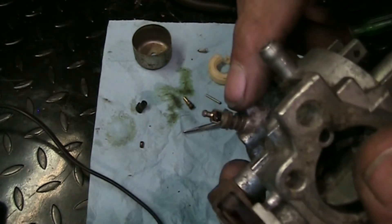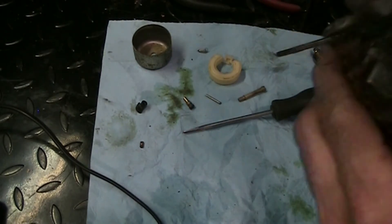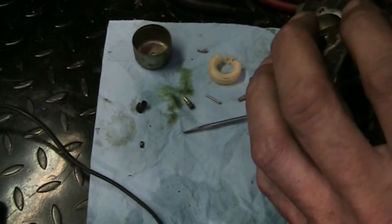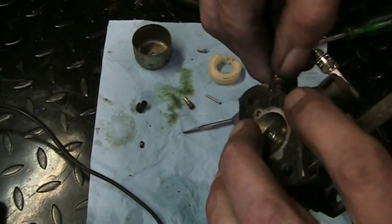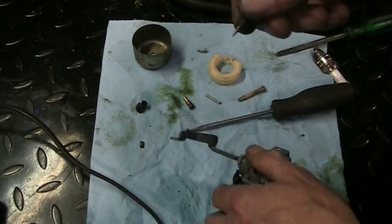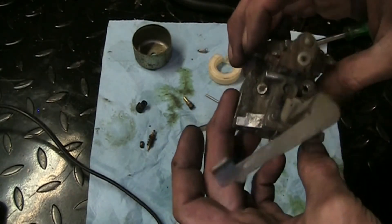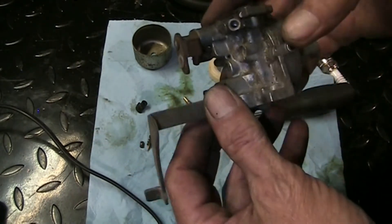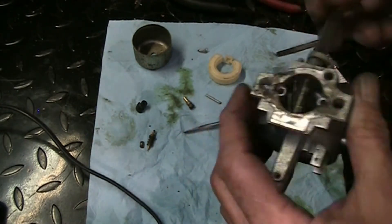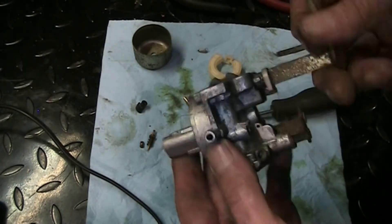One side black, the other side is naked - so there's one turn... one and a half. One and a half turns it was. I'll take it right out, put it in the ultrasonic cleaner - the spring, the needle, everything. It'll open up the hole in the carburetor so the cleaner can get through it and do its job. That's all I'm going to strip off this - I'm going to hit it with brake clean and a blow gun just to get most of the heavy goop off, keeps most of that stuff out of the solution, helps the solution last a little longer.